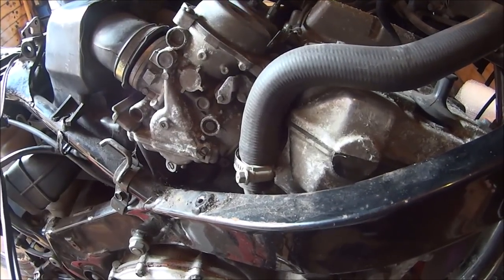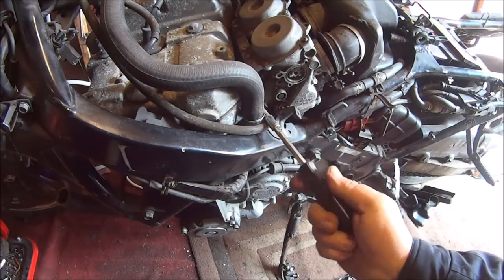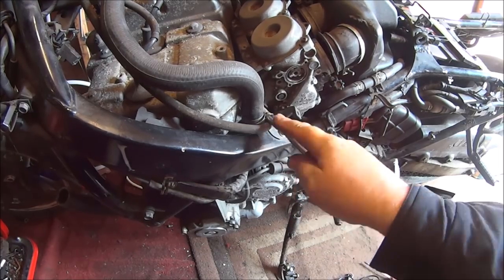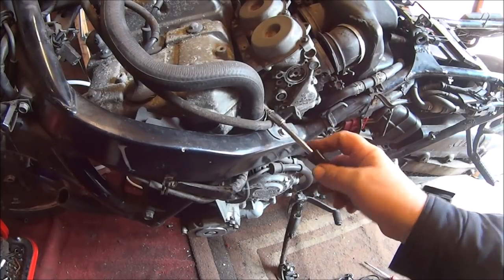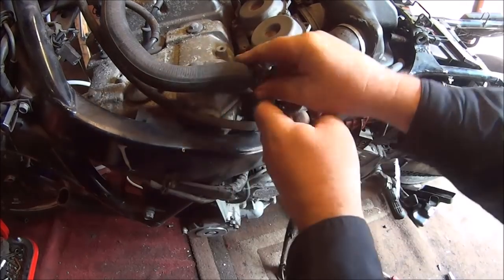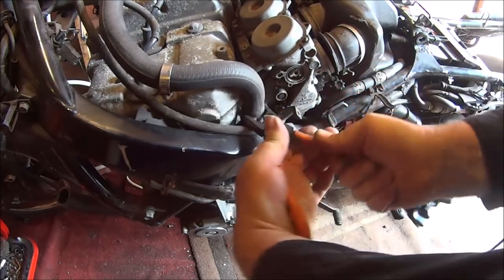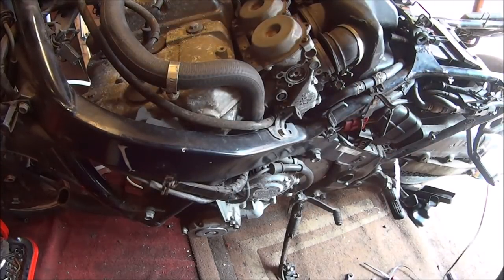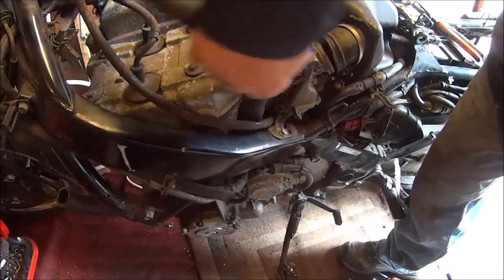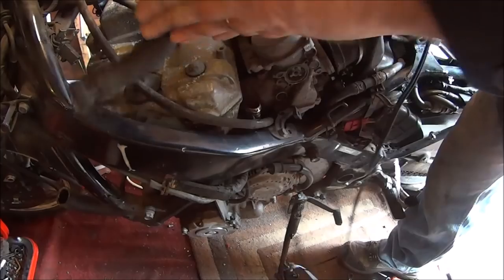Bear with me while I try and find the next one. I'm trying to find the clamp bolt on this one but I can't find it. Let's get this bloody pipe out of the way first - it's just a jubilee clip with an 8mm nut. An 8mm socket spanner bulk thing. Excuse my arm in the way - there's that. Get that out of the way. Let's break the seal on this - it's not full of water, please don't be full of water. No water whatsoever.